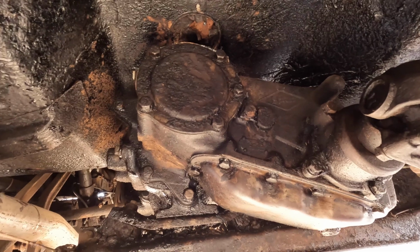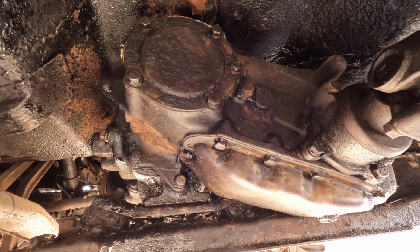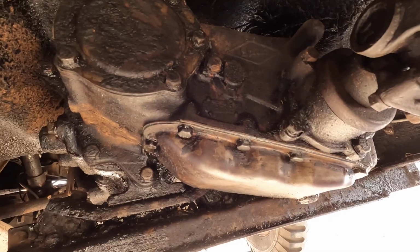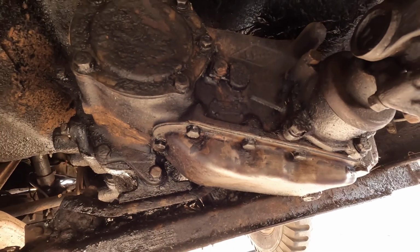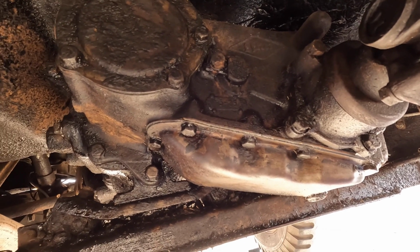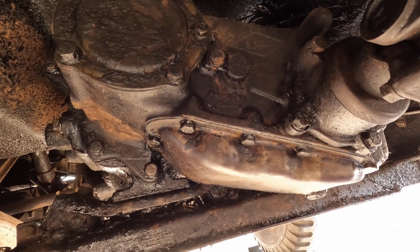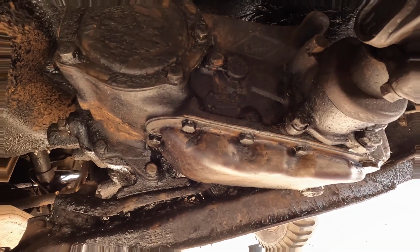We're going to keep our fingers crossed and hope this new gasket on this pan resolves the problem. So I'll drive it around the property a little bit just to get things all churned up, and then when I pull it back into the shop, I'll put some white rags underneath it, and we'll come out in the morning and check the rags to see if anything leaked out.